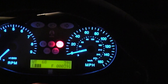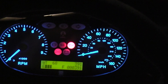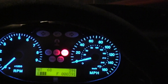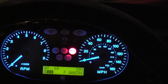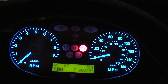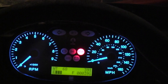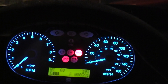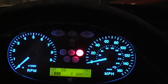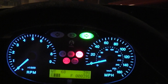The most recent changes allow adjustment of the lane change time. Right now it's about four clicks. The switch is programmable — if I press and hold to the right for about eight seconds, it enters programming mode. Now if I push it to the left, it records how long I hold that and uses it as the new lane change time.